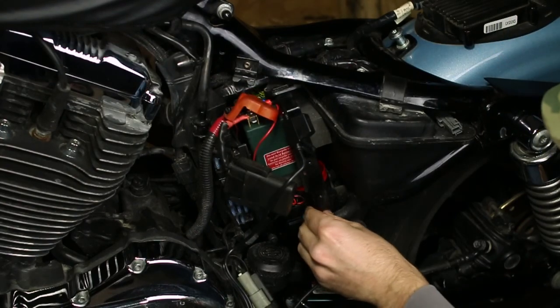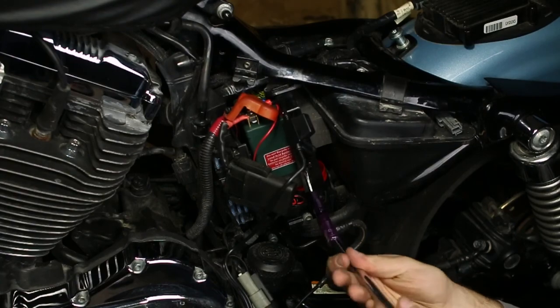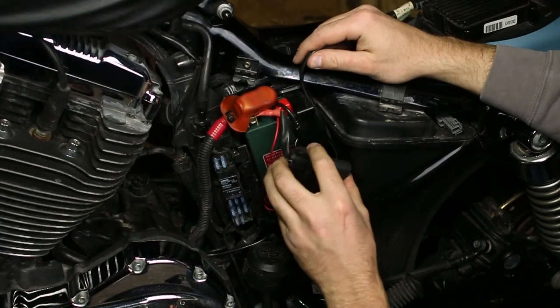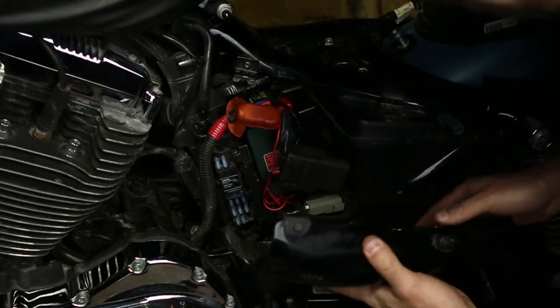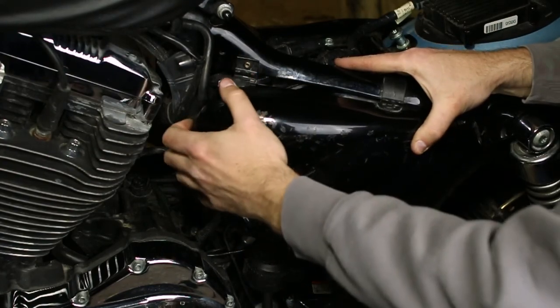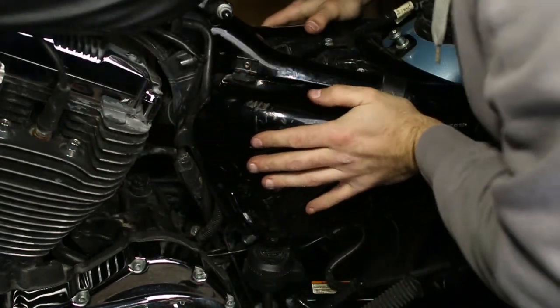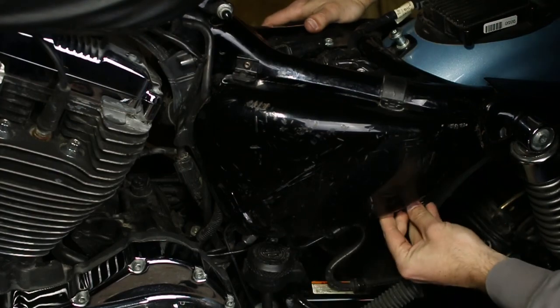Now we can bolt down our battery strap with our 10mm bolt. That way we keep everything in place and nothing can fall out of the side. Then you take your terminals and fuses, connect them back onto the strap on their clips, and then the battery cover can slide on over top. Use constant, even pressure and push into the clamps and it should snap in place. Just be careful not to clip any of the wires as they have been rerouted. Also, tuck our battery charging cable in the bottom so it doesn't get hung up.